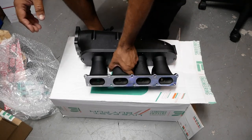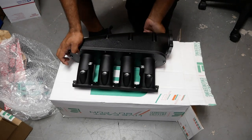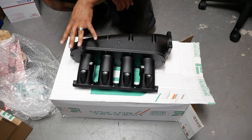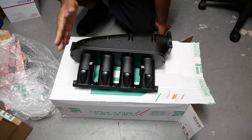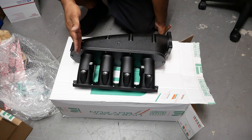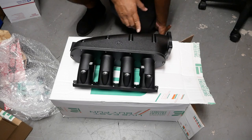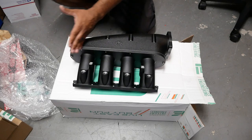These guys designed this manifold for super high flow. Similar style to the other manifold we had on our channel, where it tapers down to the end on cylinder number four to benefit from all the extra air. On Mark IVs, cylinder number four is actually the poorest breathing cylinder, so Integrated Engineering designed it so you get all your main power right into here while everything else gets evenly dispersed.